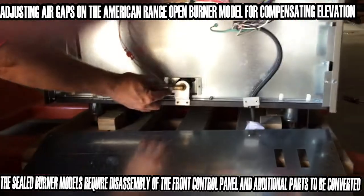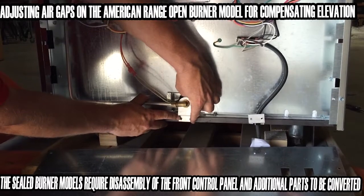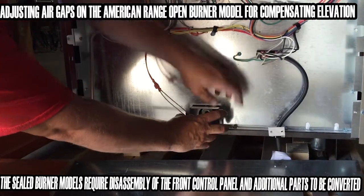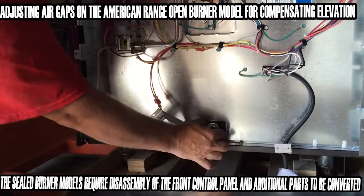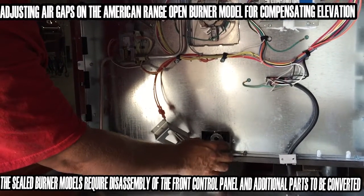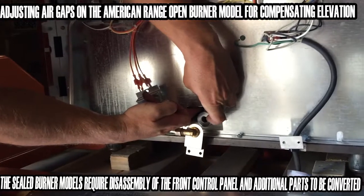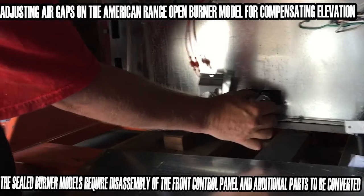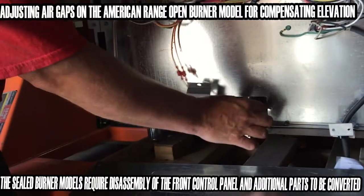Down here is a gas line that feeds an orifice that goes into the oven burner. Two more of those screws hold this into place, and you can actually lift this out of your way. There's another little sleeve right here that can be lifted out of your way — two more hex nut screws. What we have here is a barrel, and this barrel adjusts the amount of air that mixes with that venturi tube after the gas orifice. There's one set screw right back here — you just back that off a fraction, and then this barrel will turn. You're going to be able to adjust the amount of air gap on either side of this orifice and cut the amount of air smaller to lower it from a high elevation to a low elevation.